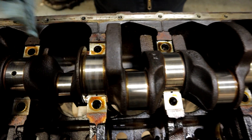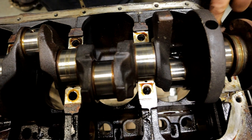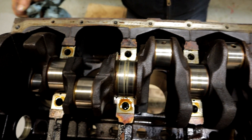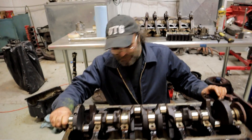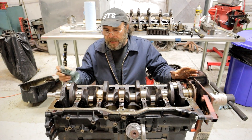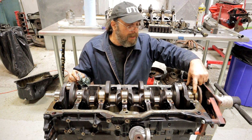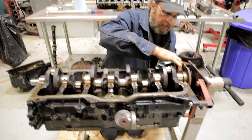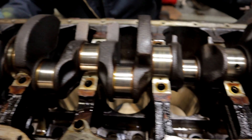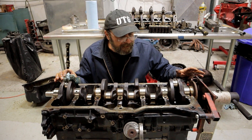This is just beautiful — I feel that I really lucked out with this engine. Your results may vary though. So at this point, here's what I've assessed: we need no work on our crankshaft — it's beautiful. I'm going to look it over a little more carefully for any cracks and check these rod bolts for stretch, but I see no evidence of any issue on the journals. My block, aside from a hone job, is good to go — it's not going to have to go to a machine shop. The crankshaft is good to go. And we're going to reuse our cam bearings.